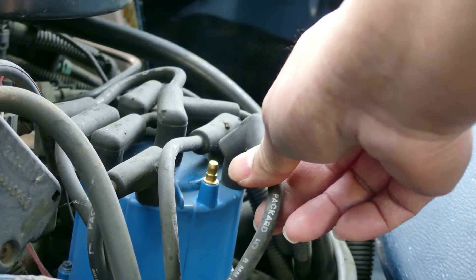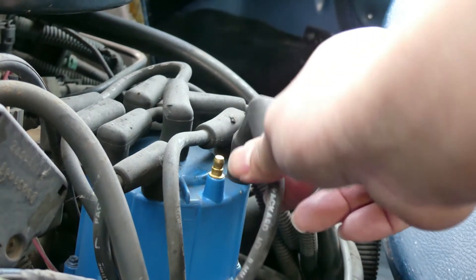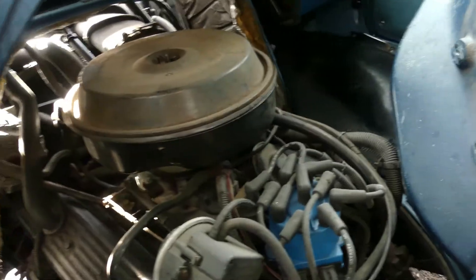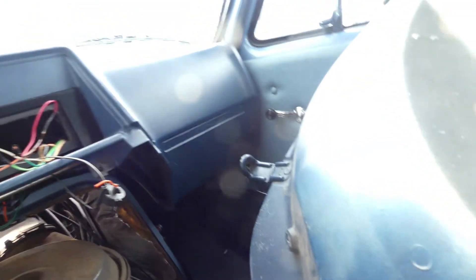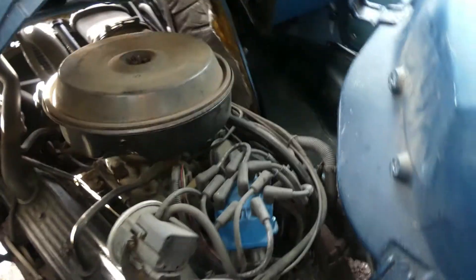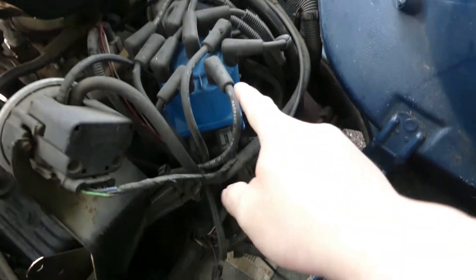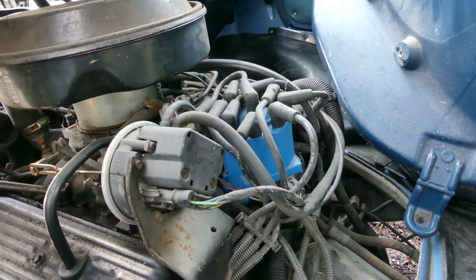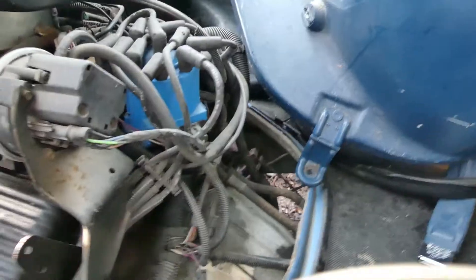The battery is very slow, but I did see a spark on the first crank. We do have spark. The battery is super low, so let me check that, but we confirmed: we've got spark. Now the next thing we need to check is fuel.